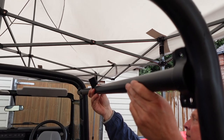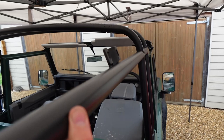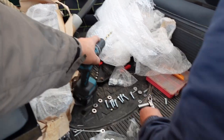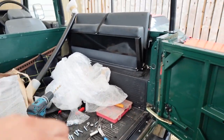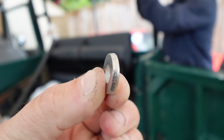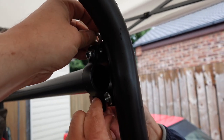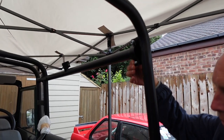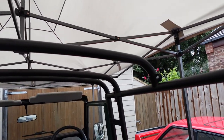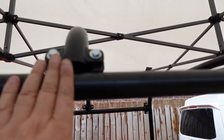These pieces are handed, and that centre piece there needs to be at an angle inwards so that you can fit your centre bar. No instructions I'm afraid, but you don't need them now because you've got our video. This super-thick washer — you get eight of these — sits sandwiched at this point so that when you clamp it up it doesn't over-clamp and crack the paint. On the central bar it is slotted up and down, so when you've got your bolts in place you want to have this on its highest setting.